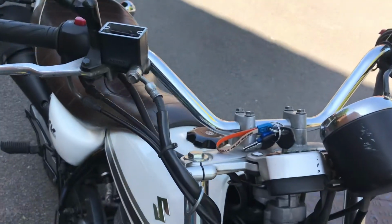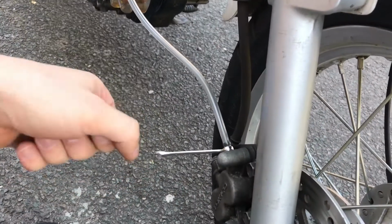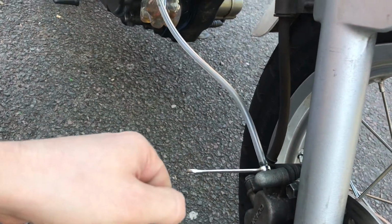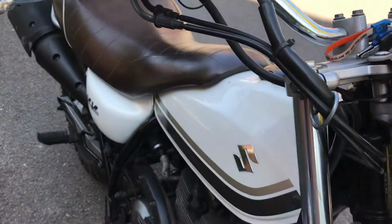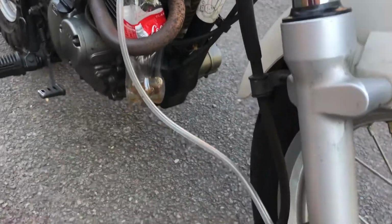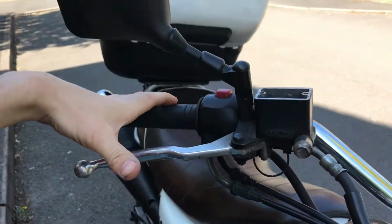Okay, so the procedure is going to be squeeze that, open that, let's watch the old shite come out, close it, then release that. So it's a two-handed job, ideally a two-people job. But so it's squeeze, you get some pressure on that with one hand, squeeze with one hand. On the right, that's my left hand, squeeze my left hand, right hand opens that. You'll feel the pressure be released on that, so that will go right down. Once that's down, once that lever is down, you close that up. Then you can let this lever out.